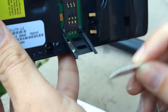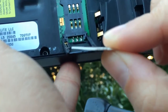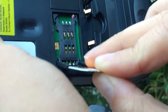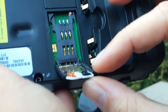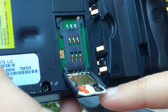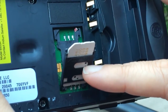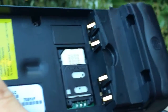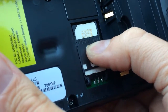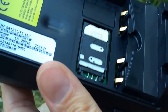If you look real closely at the SIM card door, there's actually a groove right there and also a 45-degree cut at the top. The copper end of the SIM card has to be facing into the actual copper connectors of the SIM card reader. You can see how she's got it right there. Close it — the 45-degree cut fits right in there — now lock it. You hear it lock in position. If it does not lock in position, it will not make connection and you will not get signal.